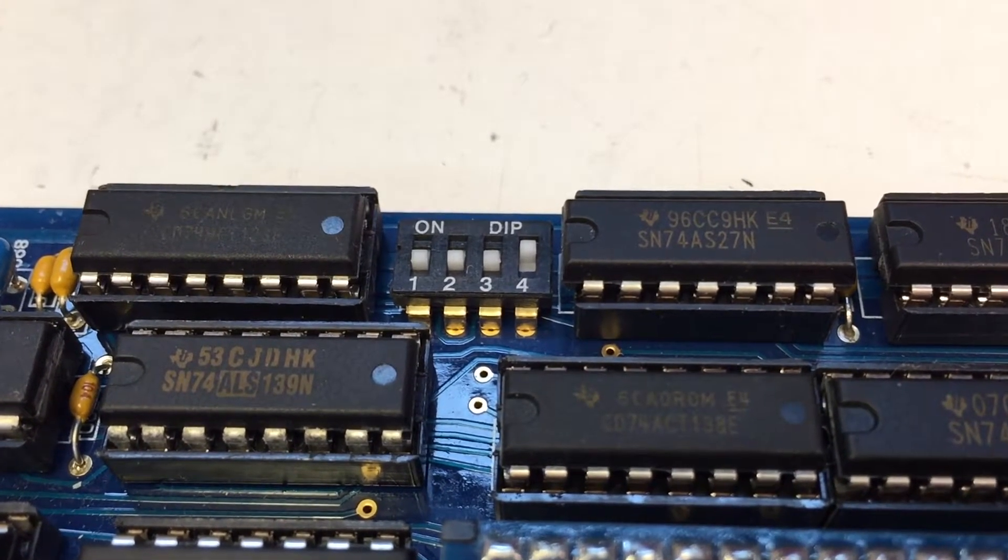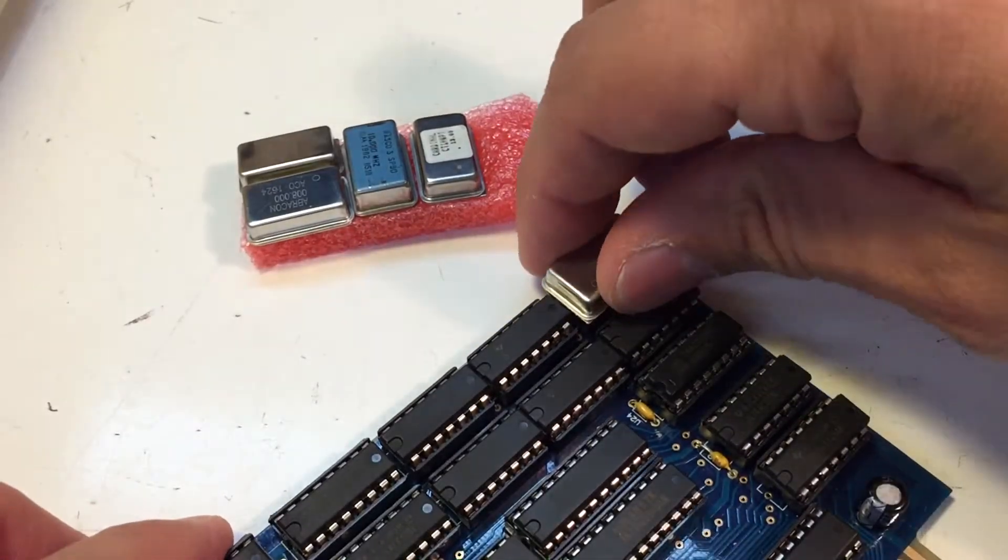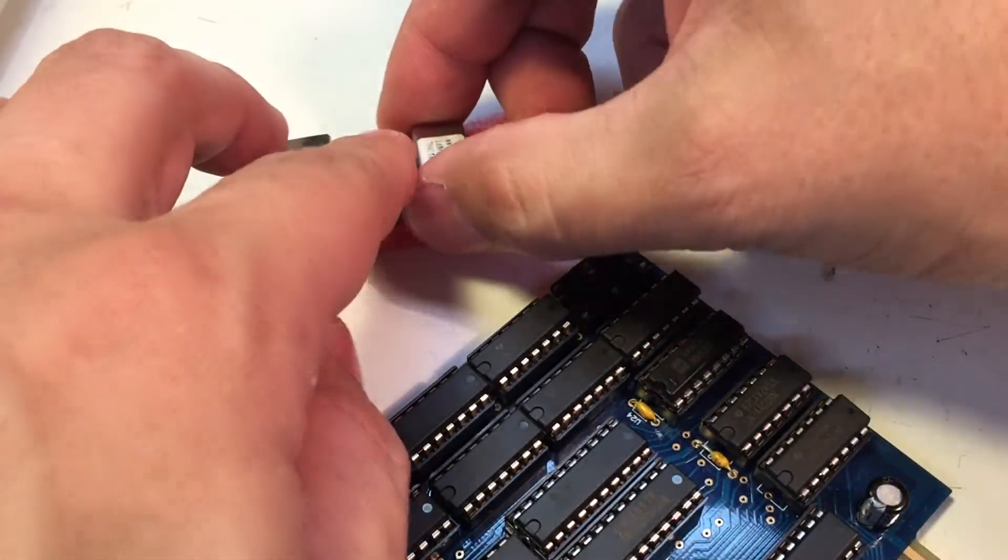You can change if it accelerates slot 5 and 7, with slot 6 always slowed down, since that's where most people put the classic Disk II card. You can also tell it how to handle the paddles, since they require original timing to return accurate results. With the replaceable oscillator, you can customize the speed pretty much however you want.